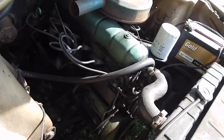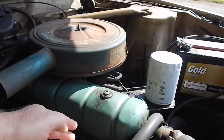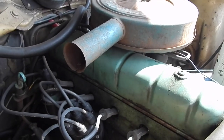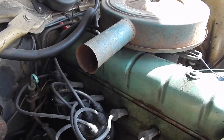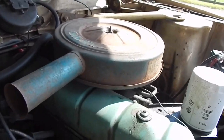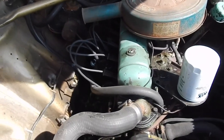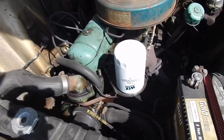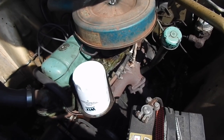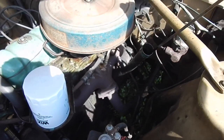It was in the Nash Ramblers as a flathead, and when they went to overhead valves, it was pretty simple — they just swapped sides of the water pump, ran some push rods overhead. I'm probably making it sound way easier than the engineers had it, but really it's the flathead block with an overhead valve system put on it. It wasn't meant to go out and hot rod and race. They just wanted to get you across the beautiful land of our Fruited Plains. Your dipstick was inside your oil fill tube.